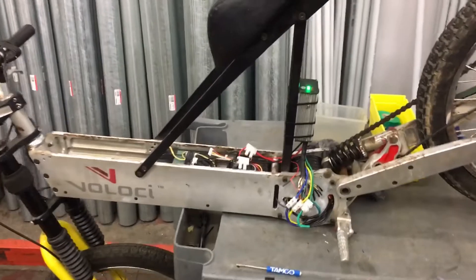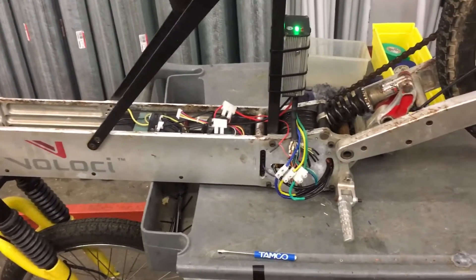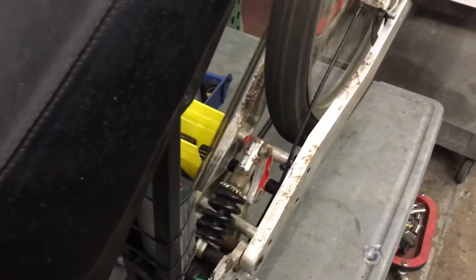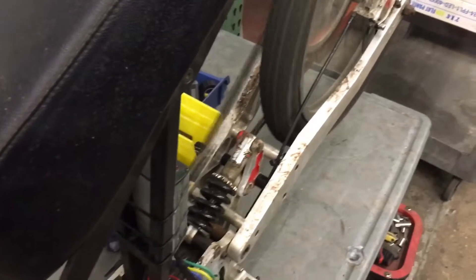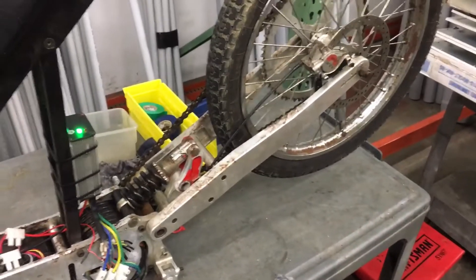I got the bike powered up with a pretty half-assed 15-cell battery pack made out of a 10-cell 18650 pack and a 5-cell 18650 pack — both different brands, doesn't really matter. It's on some pretty small wiring, like parallel 14 gauges or something, so I'm not going to pull a ton of current. I just want to see what the top speed is going to be. Looks like that was the top speed — probably 50% higher than the 10-cell, just going off the 15-cell voltage.